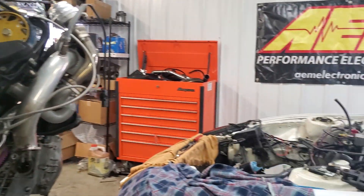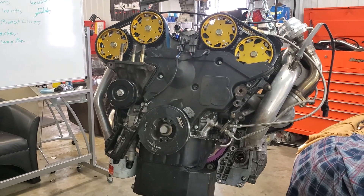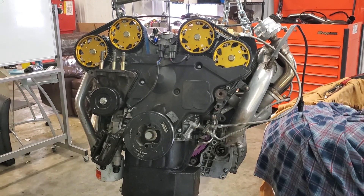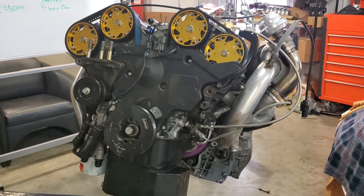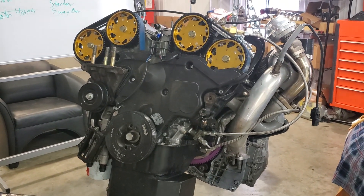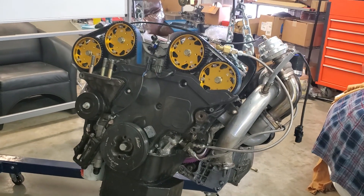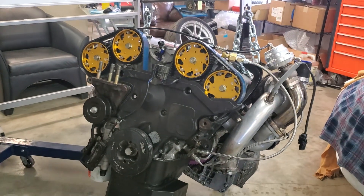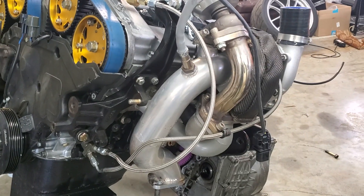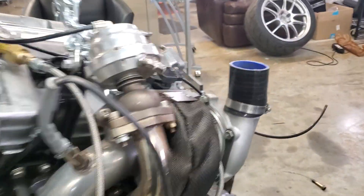Today we just really wanted to get this out. We've got a lot of client work to do, and tomorrow or the weekend depending on how we're feeling, we may put this on the engine stand. We got a pretty nice new engine stand from Eastwood — not sponsored — but they have an engine stand with a rotating gear set. The problem with normal ones is these engines are so top-heavy with the turbochargers and heads attached that when you try to rotate them they just flip over. With a geared one you can rotate it to 45 degrees or whatever angle you need, which makes working on it really nice.